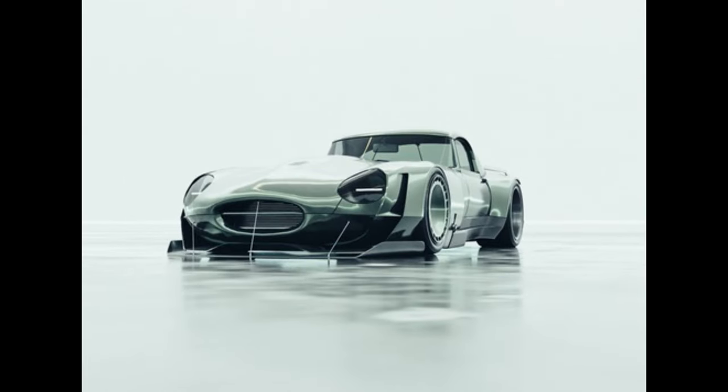These massive front arches will not only hide the new modern suspension, which is going to be a lot larger, but they also enable us to cut really deeply and bring the wheels right up to the peak of the arches. That will give it a lower stance and house the bigger brakes. You'll also see these gills down the front - they allow air to flow in and cool the brakes, but also give better airflow.